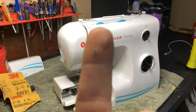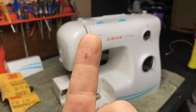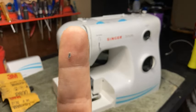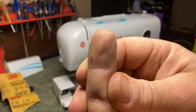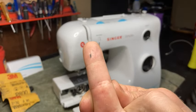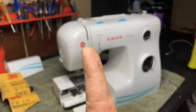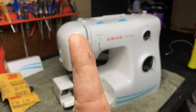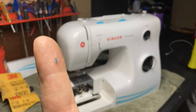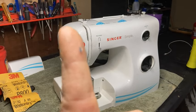You see this? You see that piece of lint right there? Really, really tiny. And it's about the same color as that metal. So it was really hard to see. That was in there. That was in behind where the hook set. And so every time I put that together, it had pressure pushing back on that hook. It was getting caught. It was pushing on that and it wasn't pushing it out. It was just staying there. So it was causing friction and causing a problem, okay?